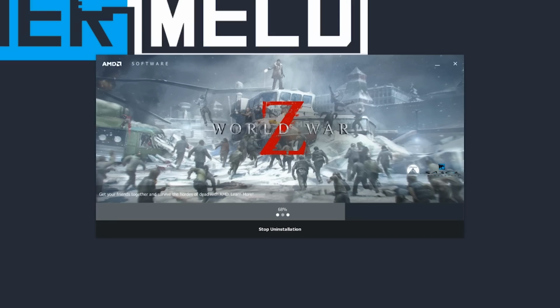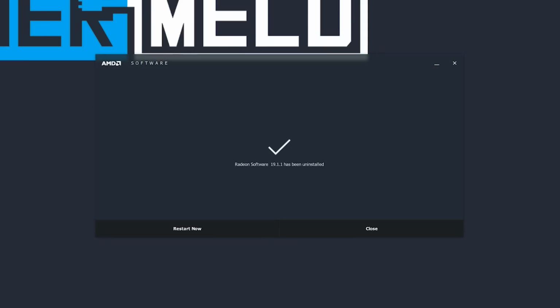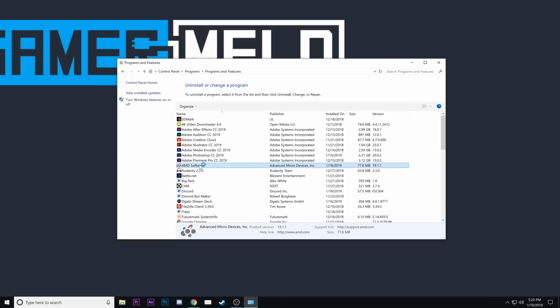And the thing is that yes, for the most part, things have gotten far more user-friendly and seamless over the years, and usually it'll work just fine, but in my opinion, it's best to go ahead and uninstall your old drivers regardless, because remnants of them can get left behind and cause issues either now or in the future. So first, head to your control panel and click Uninstall a program, then find your driver and uninstall it.